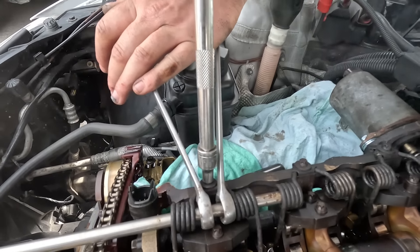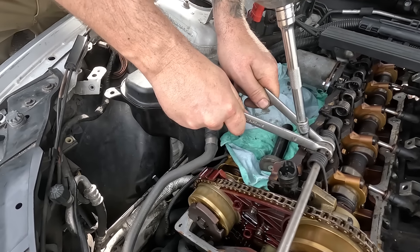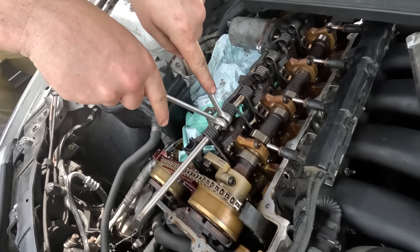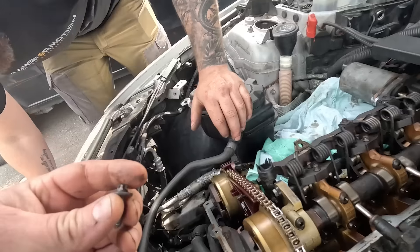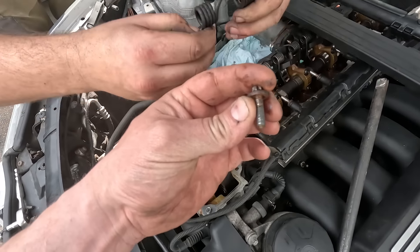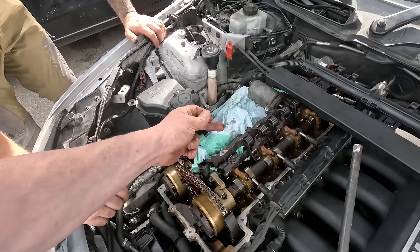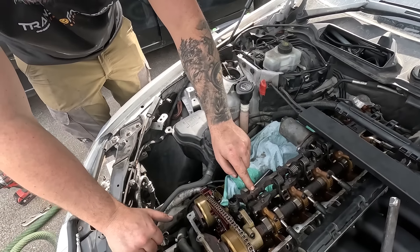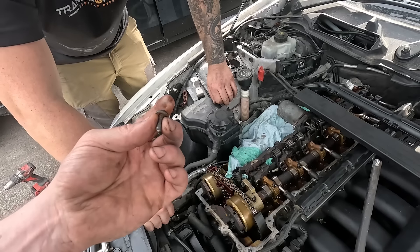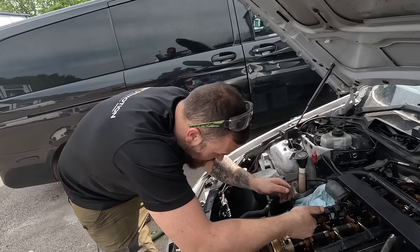Should we do one now? Go on then. So just release the pressure back off - voila! Spring off. You've got to basically, if you don't take the tension off when you take the bolt out the top, when you're taking the bolt out you rip the last threads out of the bolt or out the hole. You don't want it out the hole especially - I'd rather the bolt than the hole to be honest. That'll be cast alloy, so it'll rip first. That'll be steel. And that bit there is cast with the head in it. So you'd have to buy a whole new head. With all the springs released of pressure and the bolts removed, we can then remove the Valvetronic cam caps and then remove the camshaft and inspect the damage more.